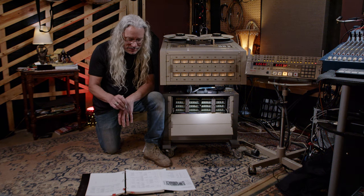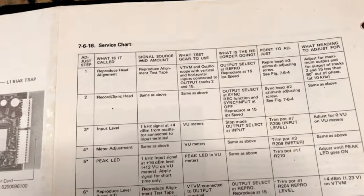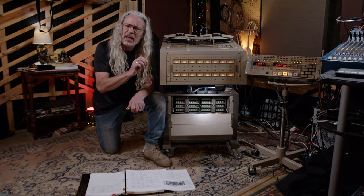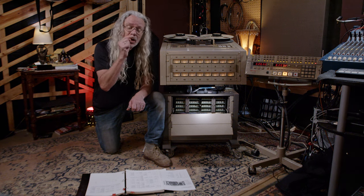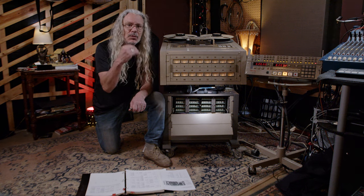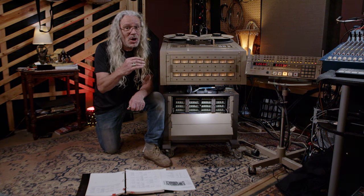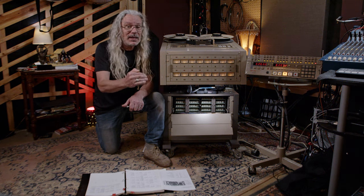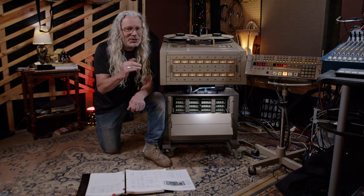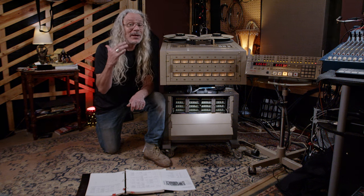The issue I'm having right now is that I've not done this in decades. I'm reading the manual, trying to re-familiarize myself with what I'm supposed to do. I put on the MRL tape and things went pretty well, but when I put on a reel of fresh tape and started checking the record level to the playback level on the sync head and the repro head, things were acting a little strange. I couldn't get consistent record levels on a couple of the tracks. I still don't own an oscilloscope or voltmeter, and I'm not going to be able to get a tech out here for weeks — so it's not perfectly right, but I just want to record something, so I'm going to give it a go anyway.